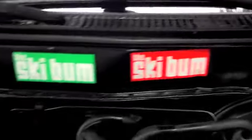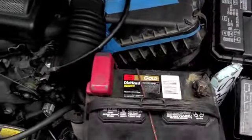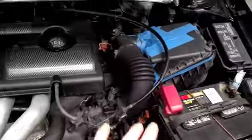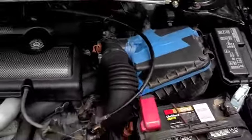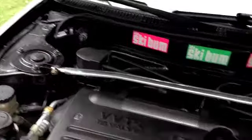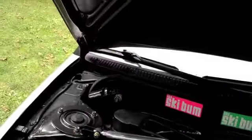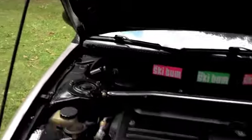I tried to keep this car pretty fun — I even tried to center the battery two inches over for weight balance. I have aerodynamics in this engine bay so the air travels in and then to the left, away from my air box, by putting vents on this side of the engine bay. That gives you a colder intake and therefore more power. Just be careful that any vents you put on the hood don't allow water to leak on anything.